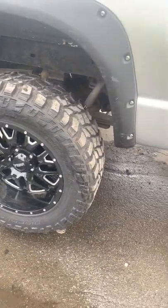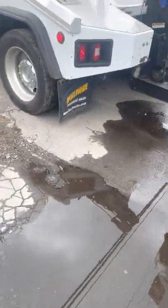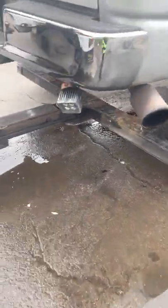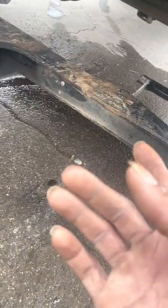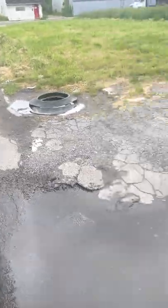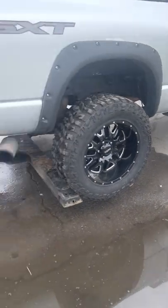Just make sure it's centered on both tires — make sure one wheel isn't hanging off the other side. Both should stick out the same amount of inches on each side. You just strap it up like you're ready to go, and that is how you use a self-loader.